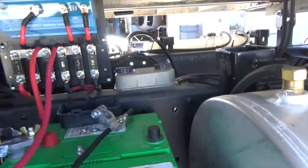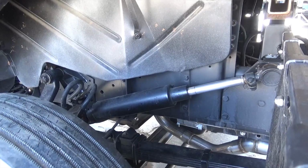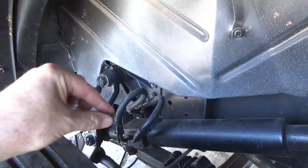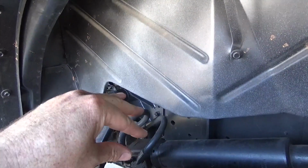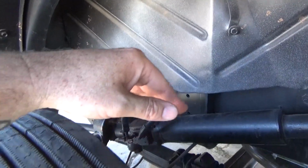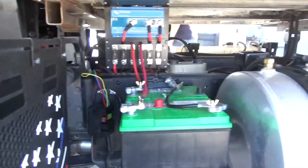A HydroBoost system is going to run our brakes and our giant steering ram with it, that this truck came with actually factory. It's a crazy system, it has this, like, bell valve or something like that. Anyways, the valve can actually feel if you tried to turn it one way and the pressure of the ram, it'll actually flip the valve in there. And if you go back the other way and it feels the tension from you turning the tire, it'll flip the valve the other way, so you have the power assist in both directions.